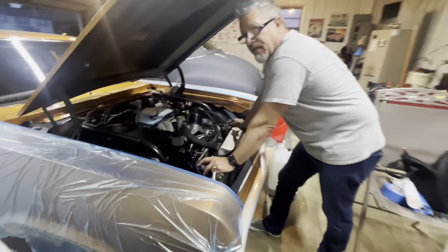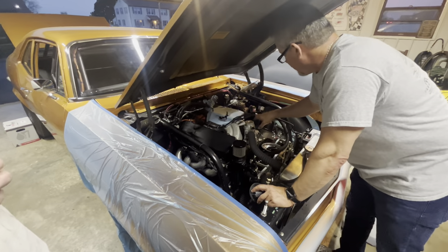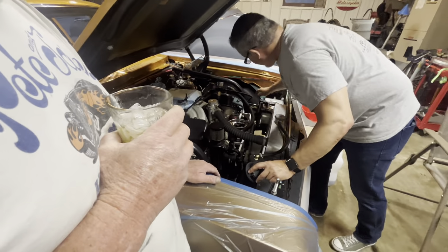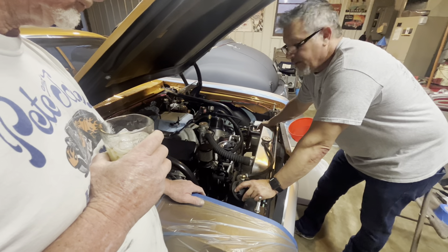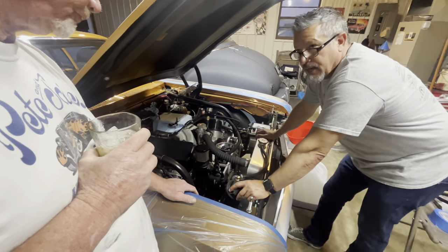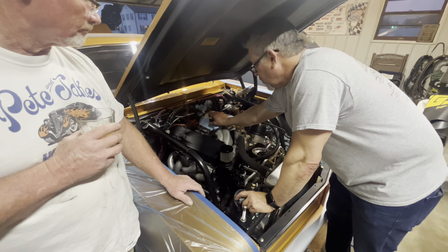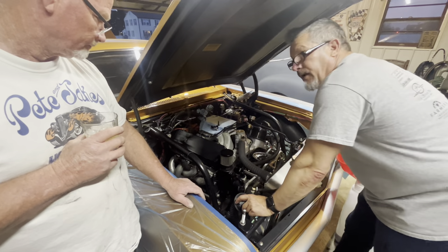No, that's the opposite — when this does not recognize pressure, it turns that solenoid off. This has nothing to do with this — this is just a bypass, and it just regulates pressure, or reads pressure. That's a little pump there. There's a little pump inside here and a regulator. So this pump should be armed — when you arm the nitrous, this pump should kick on. That means you're ready: you have your fuel pressure right, your solenoid's hot, your purge is hot. The nitrous solenoid and the fuel solenoids will not open up until this kicks on. The pump should always be running.